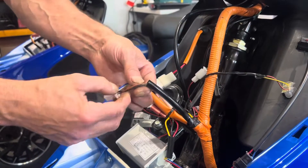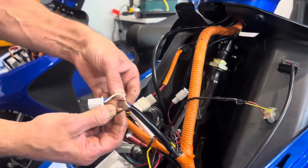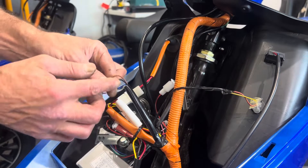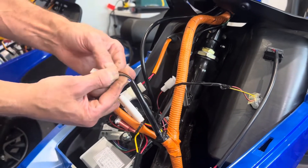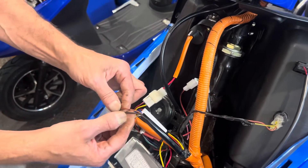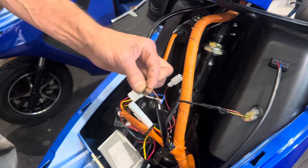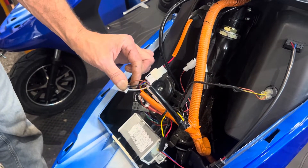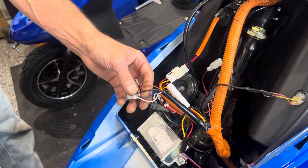If you don't want that, here's your harness for your headlight plug and running lights. On this harness: black is your ground, blue is your headlight high beam, white is your headlight low beam, and yellow is your park lights — those come on when you push your light switch one click without turning the headlight on. These wire colors are standard across all the bikes and pretty consistent.